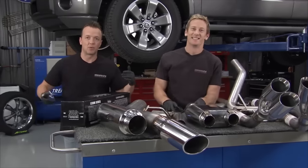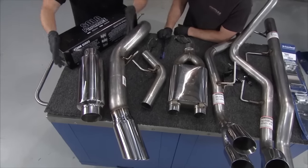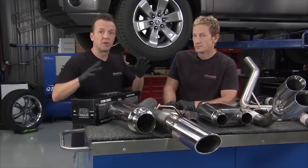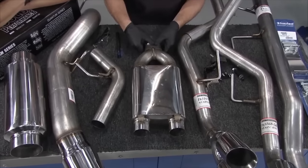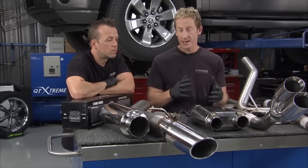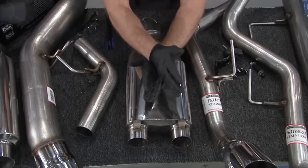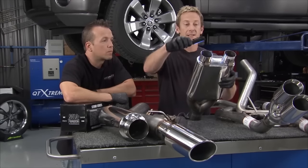When it comes to replacement options from Solo Performance, we've got two choices. We can go with a single four-inch exhaust that goes all the way back through a muffler with very little restriction — great performance, but it's a little bit louder and more aggressive sounding, which a lot of people will like. Or if you want to keep it quieter with the same performance, you go with the Mach Dual — three-inch out. There's a big challenge with the EcoBoost: a lot of harmonics built inside it. The solution is a Y coming into the muffler and then an X pattern inside, which balances out the pulses of the engine. You get that performance and get rid of the drone — you can see that design right here.